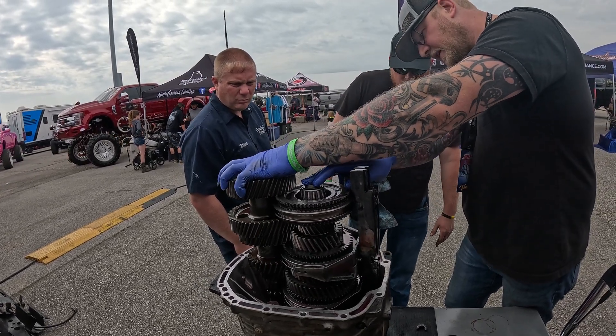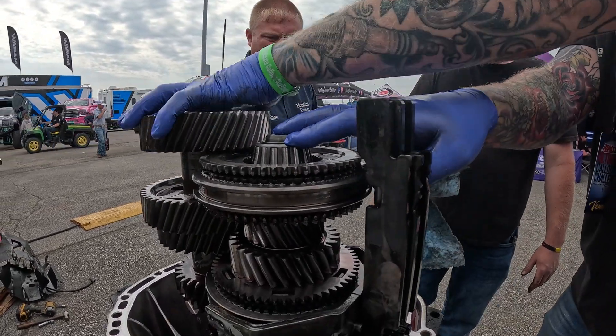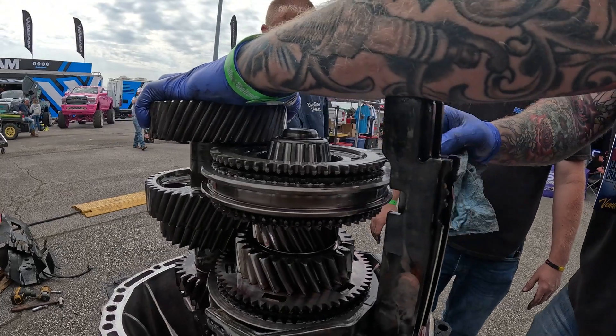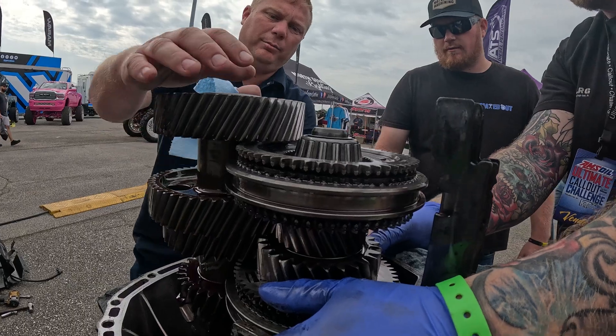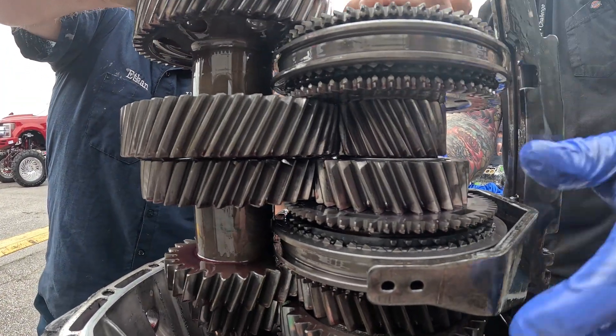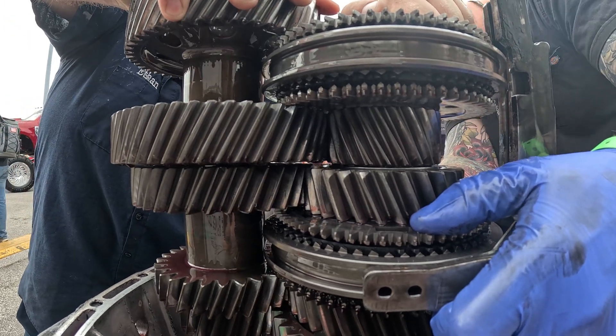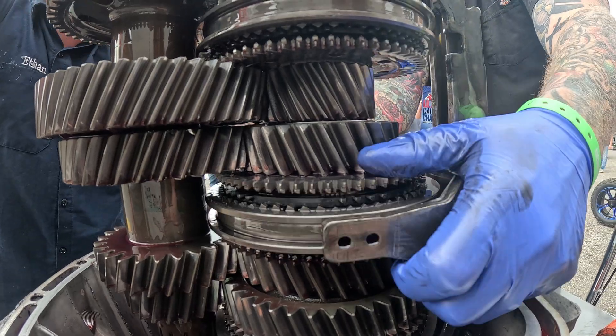As you can see right now, the shaft is spinning very, very slowly, and the clutch gear is spinning really fast. When you go to shift, you kind of push up, and those teeth are kind of pressing on each other — locks together — and that allows the slider to engage. So this is happening at like 2,000 RPM; if you put a little pressure on that synchronizer, it literally stops and you can't turn.